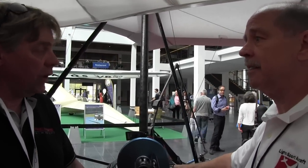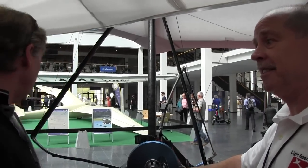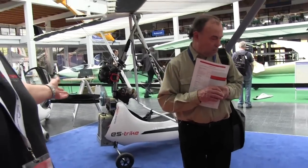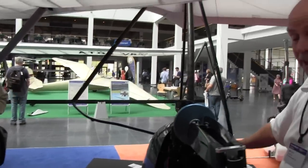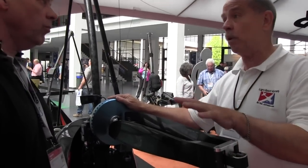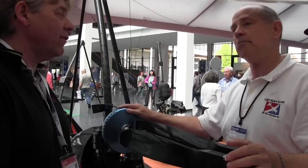When you fly with the Atos, you have 50 minutes. And we are going still up to 115 ampere, like we have there. That's a 25 kilo battery where you can fly 2.5 hours. Well, that's quite a long time for electric power. I like electric power, and on these very light aircraft, electric is already working. This is not 5 years in the future, this is working now. Yes, it's also certified for manned flying.